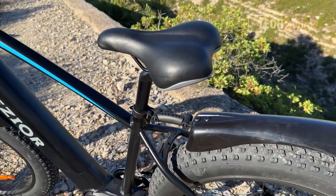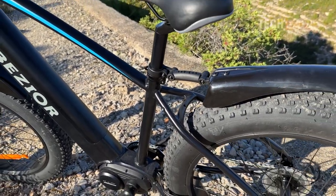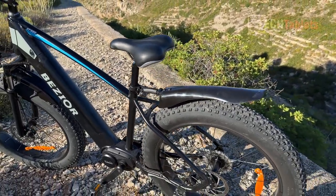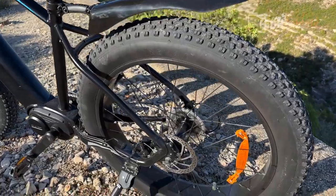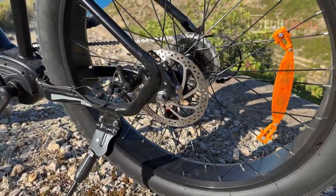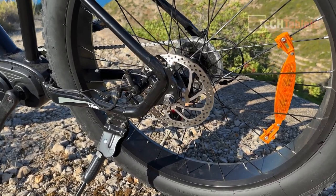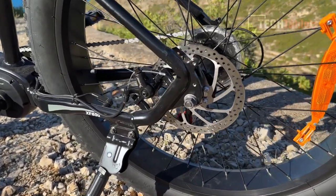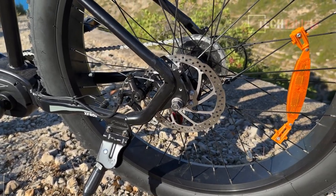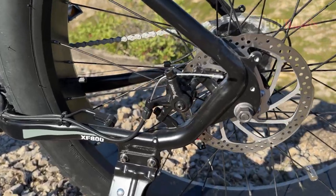The seat is wide, comfortable, and spongy. Height adjustable with a quick release, and it does cater to rider heights of 162 to 190 centimeters. The brakes are probably my biggest complaint now after riding about 52 kilometers so far. They need a lot of bedding in. They're mechanical 160 millimeter disc brakes and they're really not that brilliant. I will be upgrading these if I hang on to them — they are a Speed brand of brake.